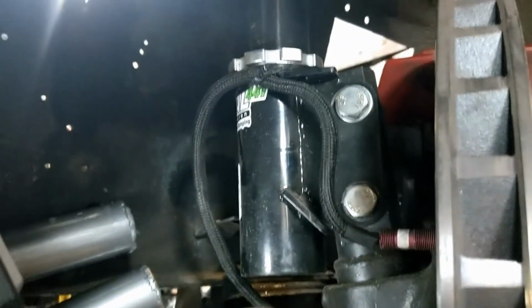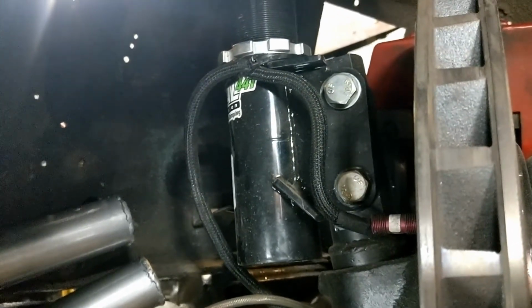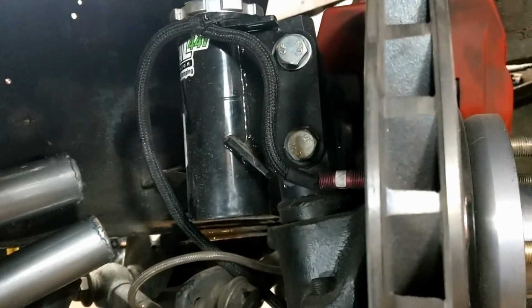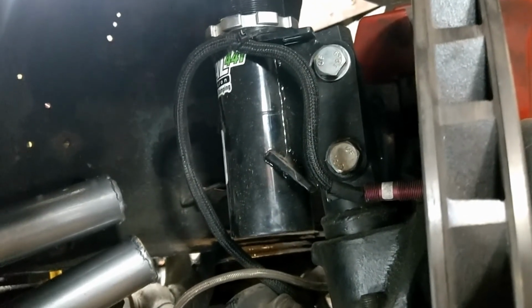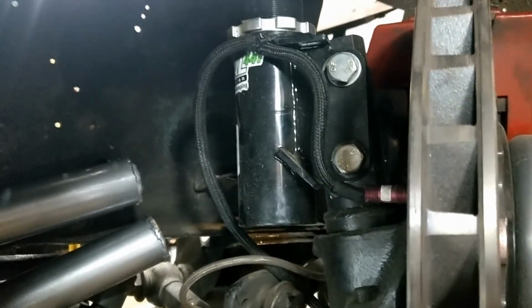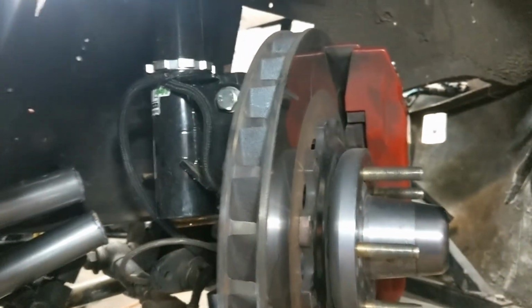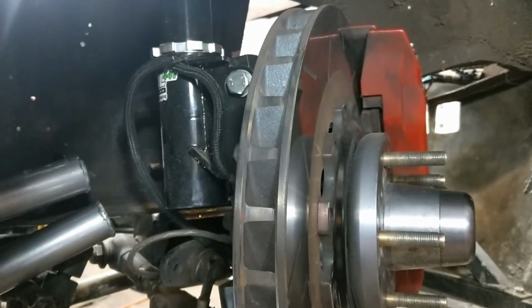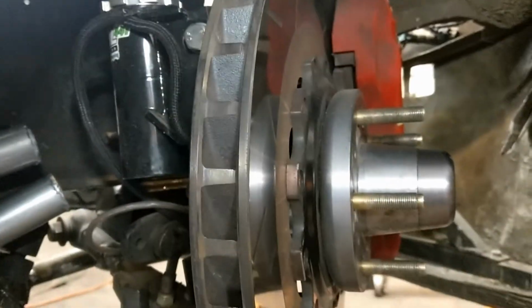And then you can bolt the S13, or probably S14 if you chose. I think the only difference is you have to make the holes bigger or get bigger bolts. And so that leads up to the Feal suspension. The other thing that's nice about these adapters is one of the holes is slotted and it actually allows you to move the hub in and out for camber. I honestly think there's enough adjustment you wouldn't even need camber plates if you ran these. They do move the wheel out 20 millimeters, but for most wheel offsets with modern wheels, that's actually a good thing for people. So that's that part.